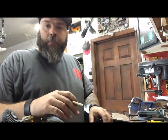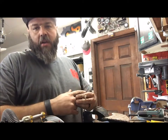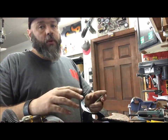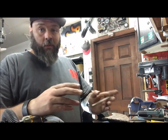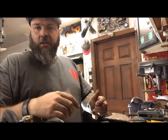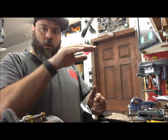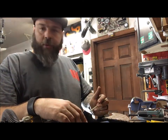For the fuel pump mount, I need to come up and mount it off the frame down below. This fuel pump makes a ton of noise — it's loud as it could be — so I really want to put it in the back of the car so I'm not listening to it when sitting still. I won't hear it over the motor when it's running, but at idle this pump's gonna be loud. I've got these pieces I cut off the step bumper on the '64 — nice thick steel diamond plate. I'll use that, cut it up and make it come up and over for the bolt tube.